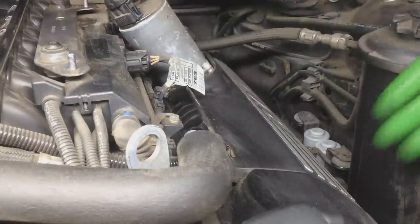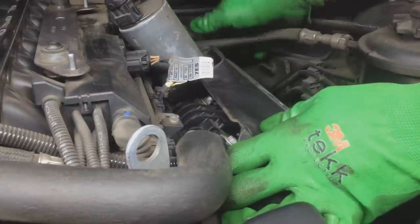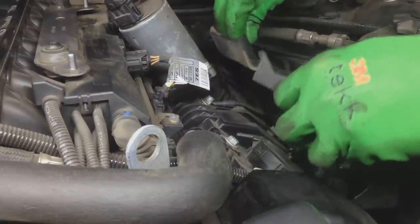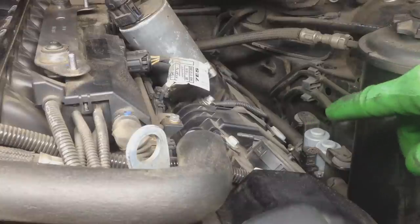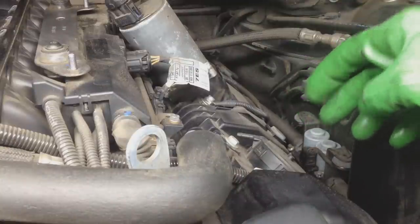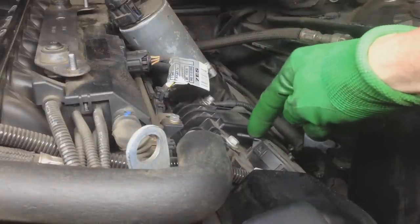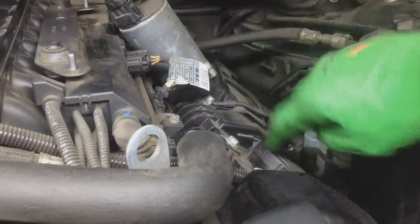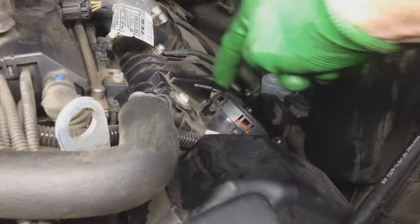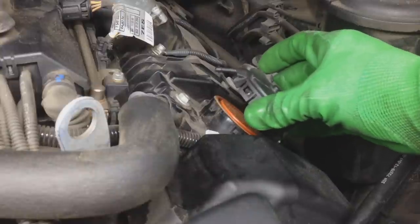On the right side, watch your tubing here and here. Get your hand underneath and pry it up - and watch the tubing in the back again. Get underneath this one, it's always easier from underneath, then remove it. On the E65/E66, this is the 4.4 liter V8 N62 motor. If you have an X5 or 6 Series, you might have a line running into this, but mine doesn't. I've watched other videos where they have a tube that connects on here - if you do, remove the tube, then once the new one is in, connect the tube back. We popped four tabs and carefully removed the cap.